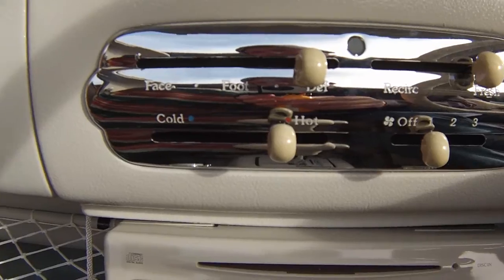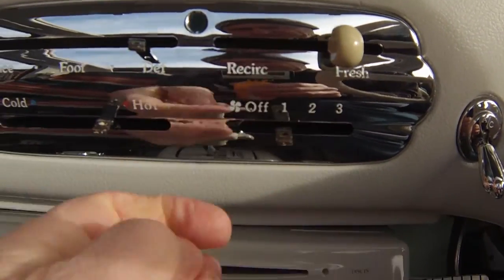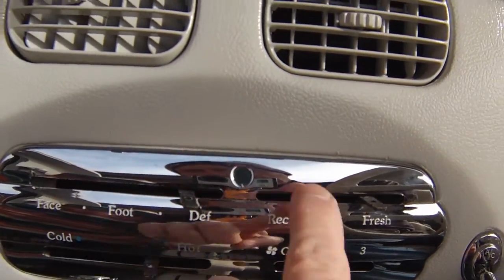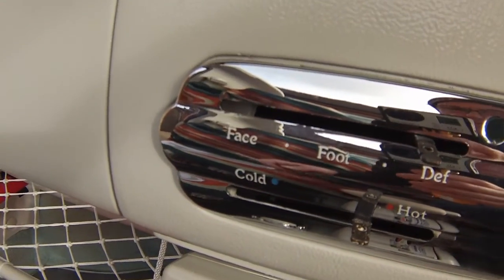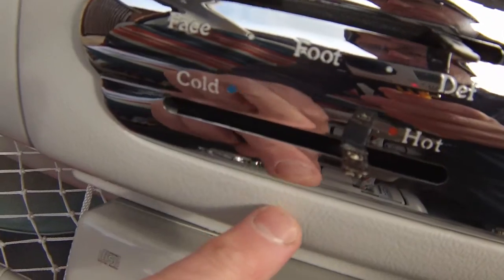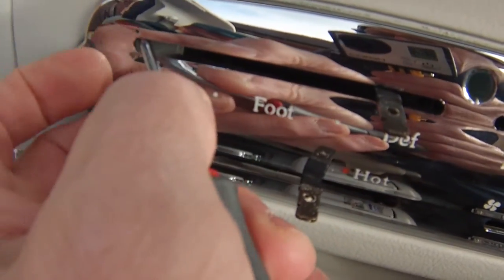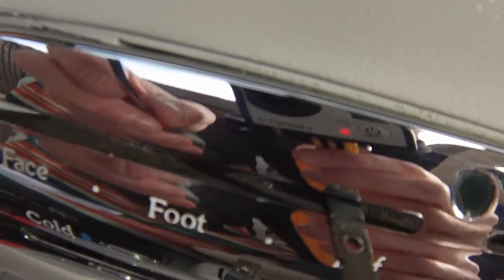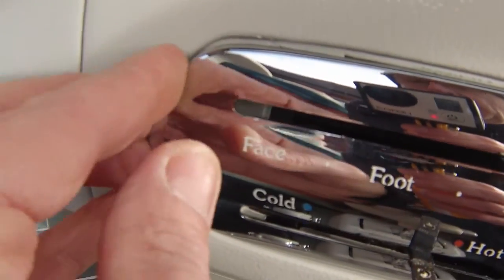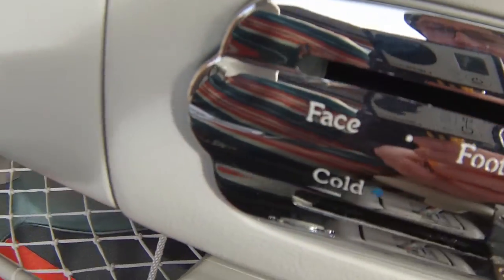On this particular car it just so happens if I kick it in nothing's happening with the light, so I think the LED is gone completely. So the first part obviously is to take the little knobs off which pull out, and then what we need to do is leverage this assembly off. It's actually held in by clips. The best way to do this rather than put the screwdriver in here and lever it off - which will leave a mark - is to put the screwdriver in one of these slots and actually pull it.